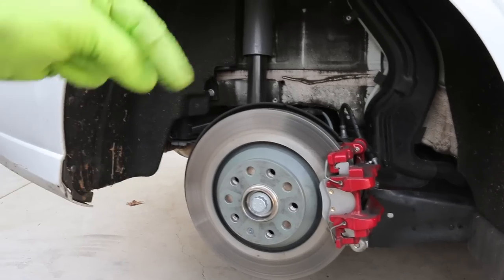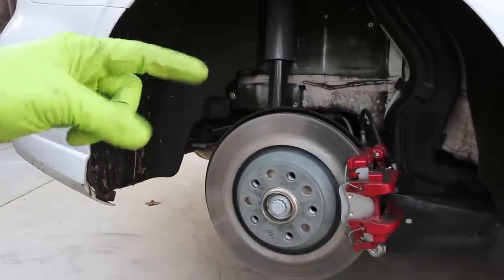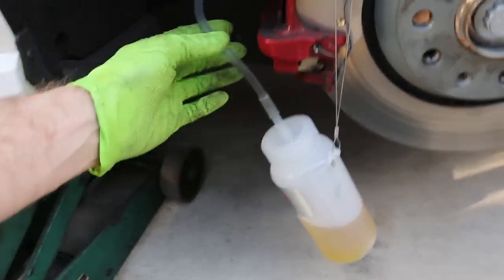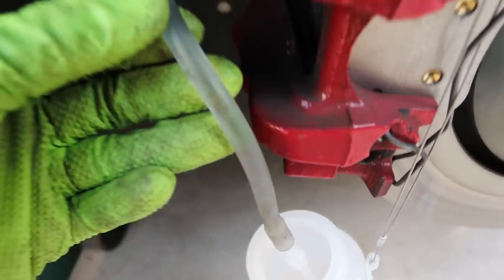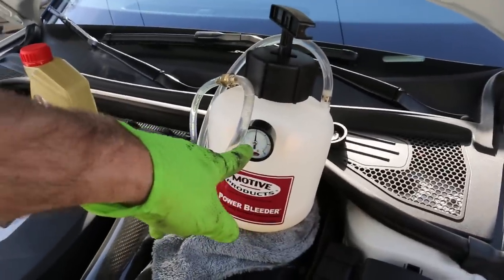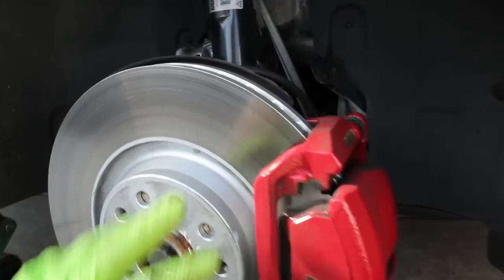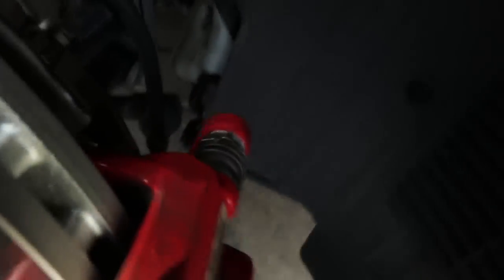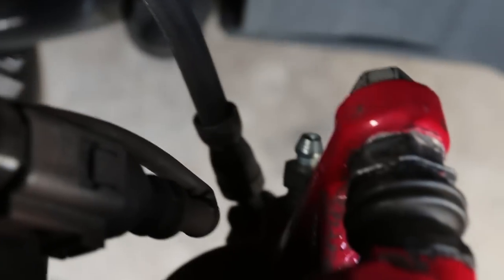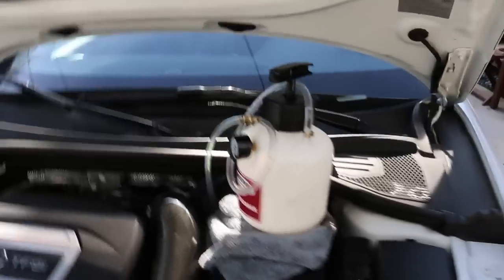Pretty much done with the left rear — the fluid is bubble-free and super clear, so it's ready to go. I'm keeping the power bleeder pumped up to 15 PSI throughout. I have the new Cobalt race pads in here plus new rotors, because my old rotors were destroyed from the Laguna track day. My biggest issue at Laguna was brakes — they were fading and it made me drive a whole lot slower. There's the bleeder screw on the front, so we'll do the same thing: crack it, bleed it out until it's clear.